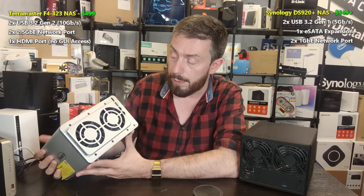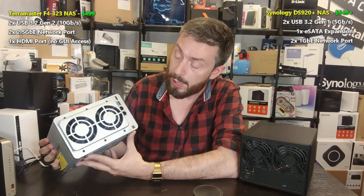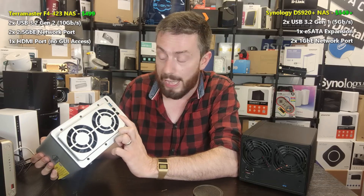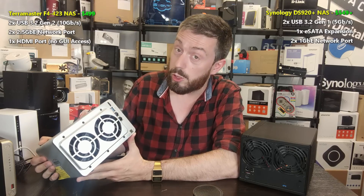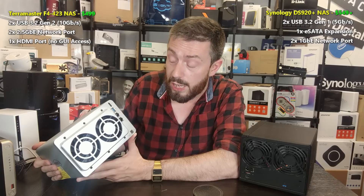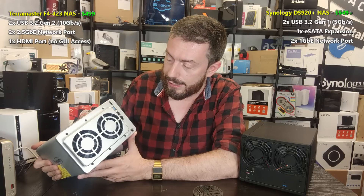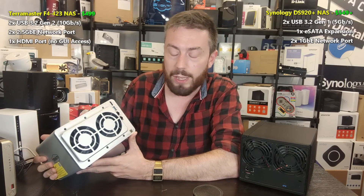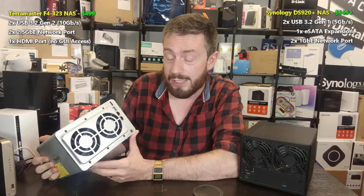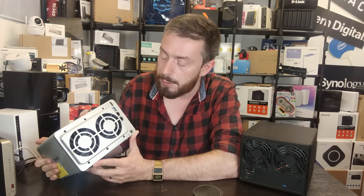The TerraMaster on the other hand arrives with two USB ports at USB 3.2 Gen 2 — so 10 Gb/s or 1000 MB/s. They can be used for expansions or with 2.5 GbE and 5 GbE USB adapters. The two LAN ports are 2.5 GbE each, giving between 250–279 MB/s per port, and when combined with a smart switch that supports 2.5 GbE you can hit 500–550 MB/s. There's also an HDMI port, though it's only usable for console access and debug.